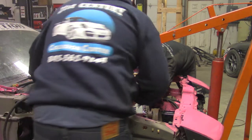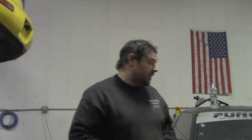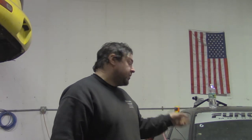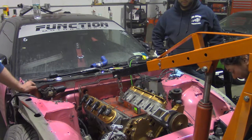Is the motor kind of lopsided, I guess you could say? Right now, the LM7 is leaning back 2.8 degrees, which is close. We want it to be between 3 and 5 degrees. We're going to go for 3, so we're almost there, but we're basically going to have to determine that when we build the transmission mount, because that's what will determine its final, like, pinion angle, I guess is what that would be. 3.2. So that's actually a reasonable...